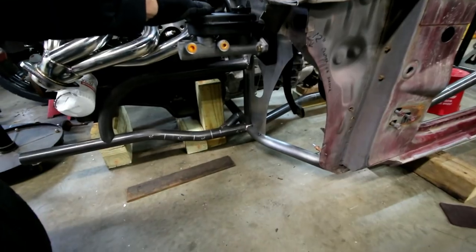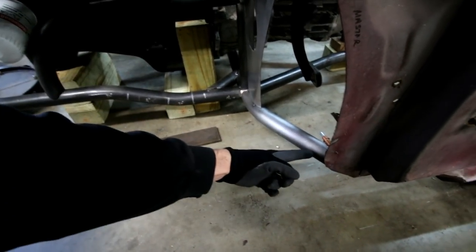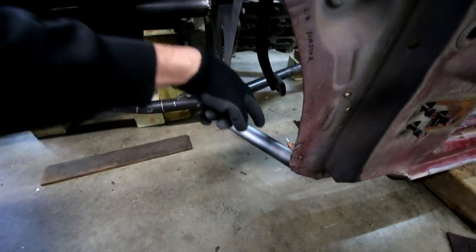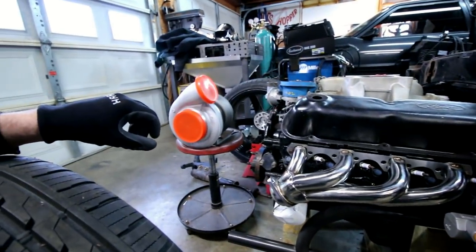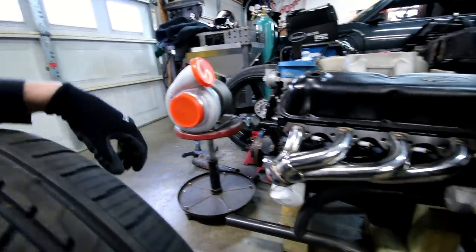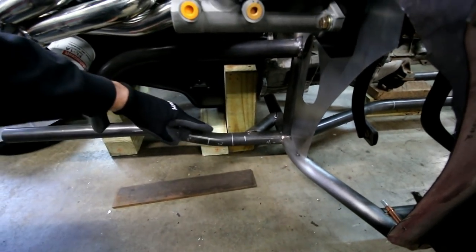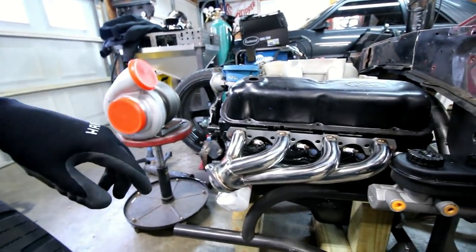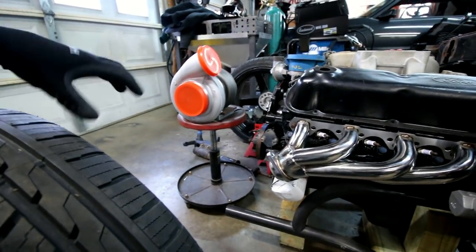So the idea as of right now on the front suspension is that there'll be two Heim joints, one out here, one in here. All right, so the one out, the actual tube will come up, probably out like this, and then up here to house the top of the strut. So it'll be your strut tower. Then the other tube will come off this, come at a lower angle, then maybe up and out and tie in and kind of triangulate that. I'll put some bracing in there some way, and then the strut tower will be here.